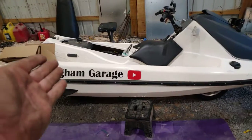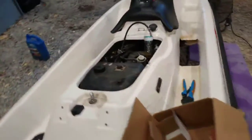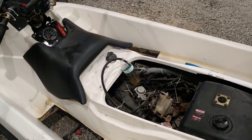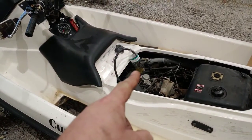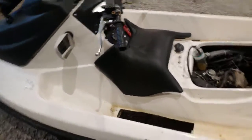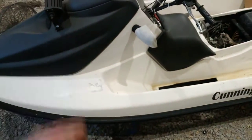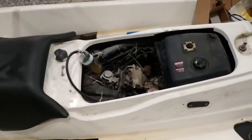It's another day. I've got some garbage laying on the jet ski. The radiator is in. I'll show you what it kind of looks like from the top. That line is for the overflow for the radiator. The overflow is way up under there where you can't access it. It's a really old water bottle, like a little jug that came with the scooter — I hate it. So I unplugged the line and just stuck it in that for the moment. What I'm gonna do is take this line, wrap it through the body, have it come out right here, and I think I'm gonna use a glass bottle — like a whiskey bottle or something — and make a mount right there and make that the overflow. Tell me what you guys think about that. Or I might just get a replacement overflow bottle and put it back the way it was.